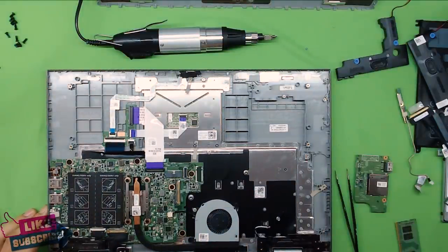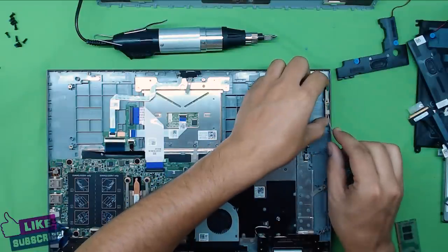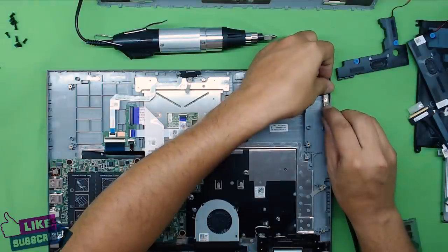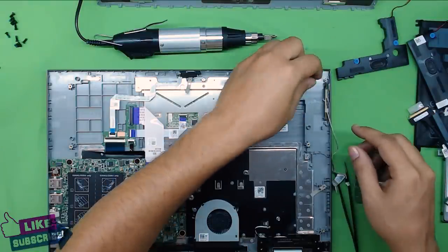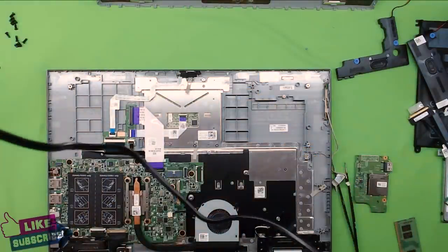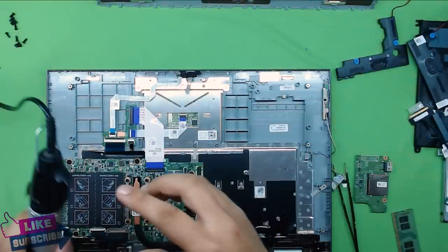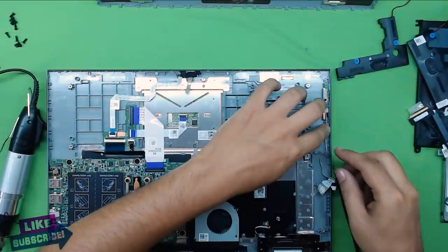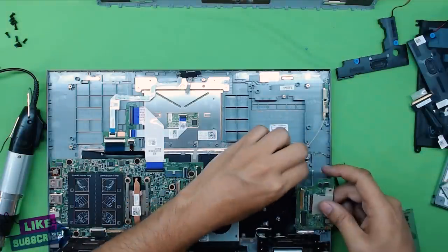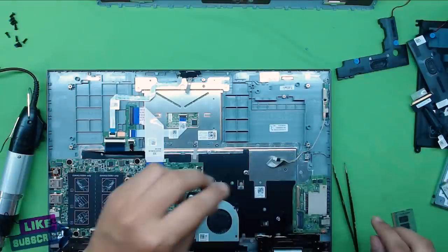Next, connect the power on/off switch in the corner with one screw holding it. Then plug in the Wi-Fi board connector and the SD card and extra USB board — put the two screws that hold it in place.